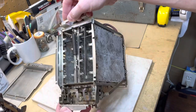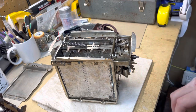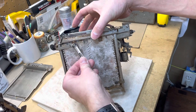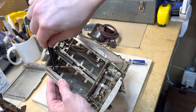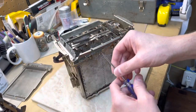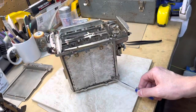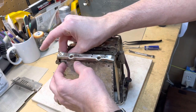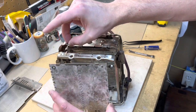I have to take this piece out - it fits into these two holes here, and the ceramic little cylinders would insulate it there. To take that piece out, I'm going to take out this screw here - there's a nut on the outside, I'm going to loosen that first. It's a quarter inch here, so I'll just get that out. Now this piece is in the way a little bit - move it up out of the way to allow me to pull this out, take the other one out down here, take that nut off.